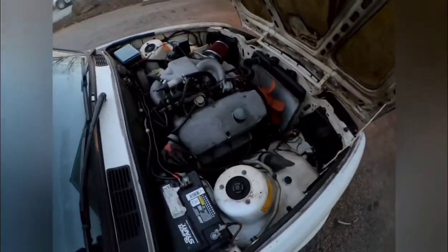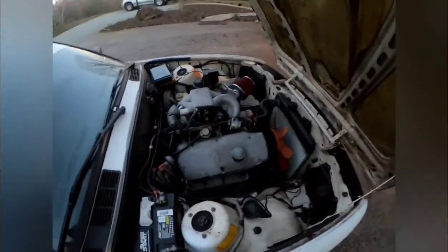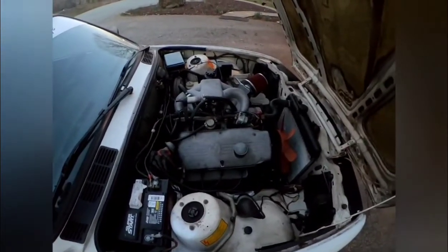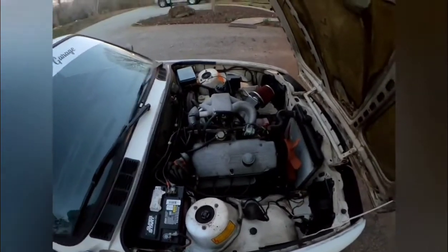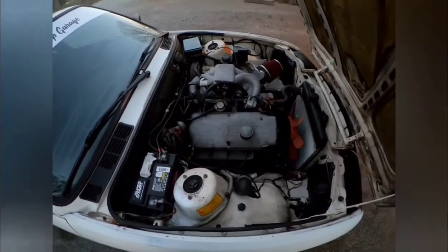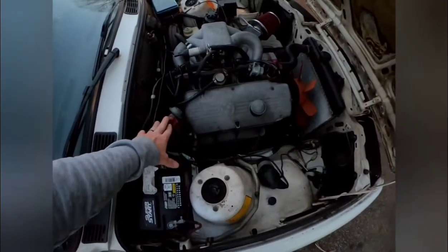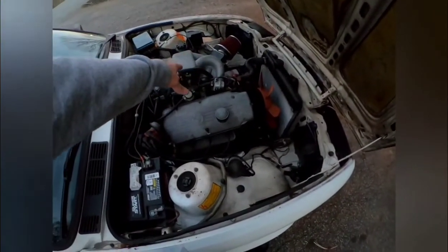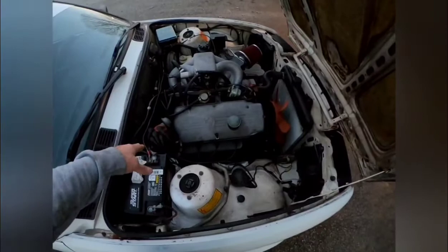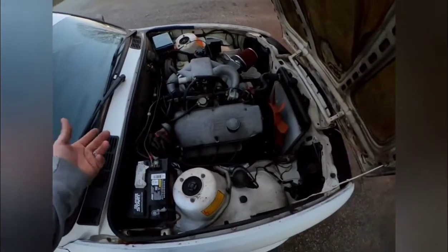It's all back together — it's a pretty quick deal. It didn't take me any time to figure out the right hole size; I drilled that first hole and it gave me the results I wanted. It may cost you 15 cents — try three different sizes to see which one gets you the desired idle. Keep in mind I'd already tried adjusting the timing and adjusting the idle itself. I could not get the idle to go below 1300 RPM; if I dropped the timing too low the car ran like crap and had no power. So with that done, let's see where it's at now.